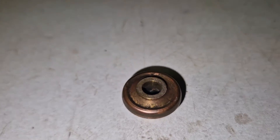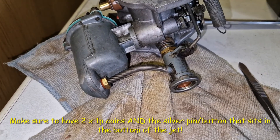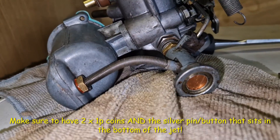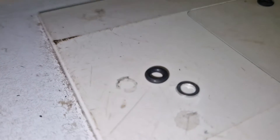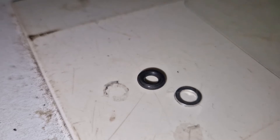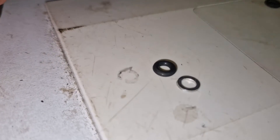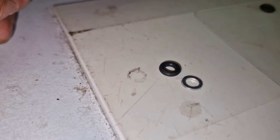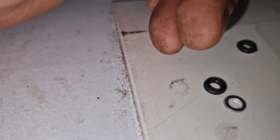We'd rather just have a fixed jet, making it easier to do the tuning and get that dialled in as best we can. The carb is now reassembled — you can see the pennies in the bottom. I'm having a hell of a time with it leaking. Inside, there is a little silver washer and a rubber one. The silver washer is supposed to squash the rubber one via this nut, so the rubber deforms and seals against the outside and also the tube on the inside, which has a copper tube insert up the middle. That's what's meant to cause the seal. Here's the first one that was leaking — as you can see it's damaged but it did deform a bit.